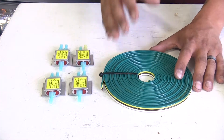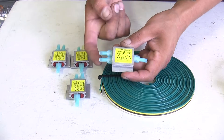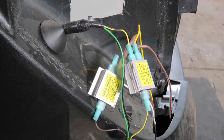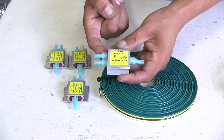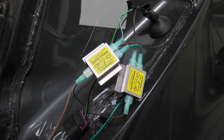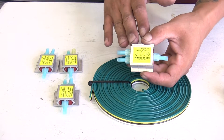If you don't want to have to drill a hole into your taillight housing, our diodes are going to be a good option. Our diodes are going to use the factory wiring on our CR-V — basically we're going to cut the taillight wire, it's going to go into our diode, and then the output is going to go to the bulb. We're going to have this other length of wire that connects up to the front and runs into our diode as well, so we'll have two inputs and one output. All of our lighting functions are going to be going to our factory bulb, and the diodes themselves are also going to protect our factory wiring from any kind of back feeding or any other kind of issues that may arise on the motorhome end.